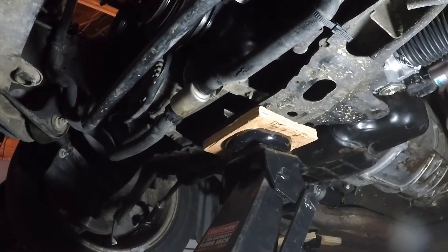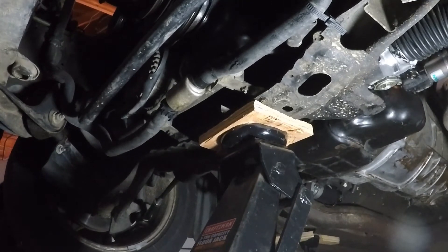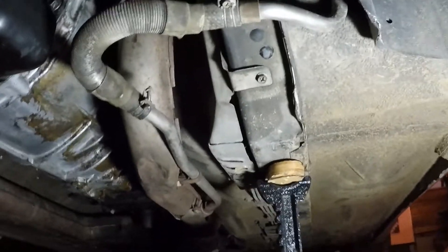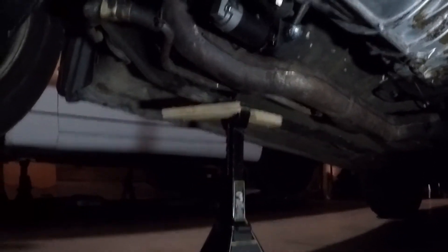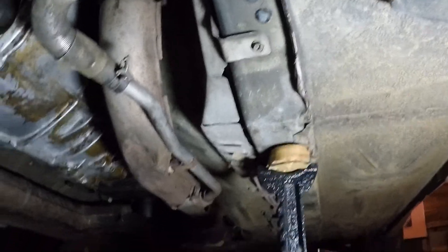Don't screw that up or you'll screw your car up. And I'm not responsible if you screw your car up. I'm jacking mine up right now because I've got it on some jack stands and I need to lower it off the jack stands. Here's where you put your jack stands — underneath these rails. And not at the very front. There's actually a little seam. I like to put mine under the seam. You put your jack stands underneath those frame rails.